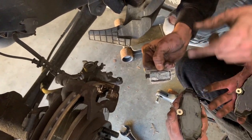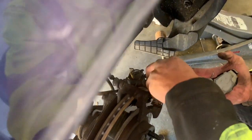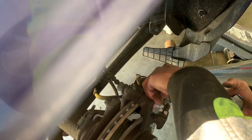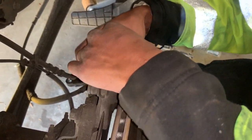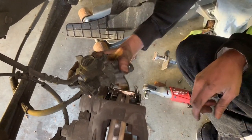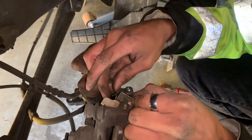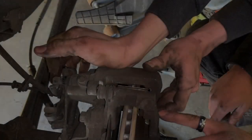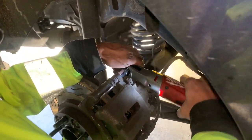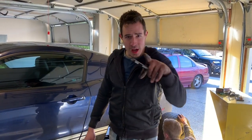Just like the other side, we lubed the back — not the friction components, because we're not dumb and we're not dying. We're using brake lube. That went in nicely. We put the shims in — top and bottom. We had to reuse those. Now we just need to put that bolt in there — a little tighten action. Now that you're done putting your calipers on and the car's up, all we've got to do is put all the wheels on and NASCAR this bad boy.